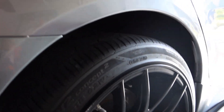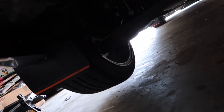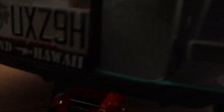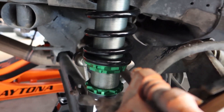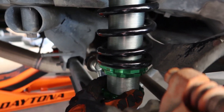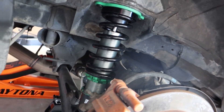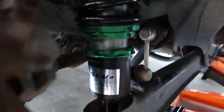Looking at the rear wheel gap, it's about three fingers on both sides. Now that we have both wheels off and everything's on jack stands, we're good to go ahead and adjust the rear coilovers. It's the same process as the front ones - bring the top one to the left while leaving the bottom one alone, then unlock it. The current gap on this side is about 1.3 inches; we're gonna raise it to about a half-inch gap. Driver side is done - that's at half an inch.